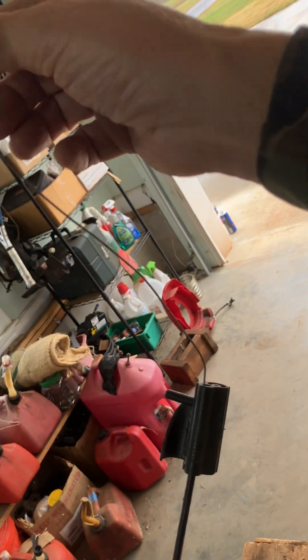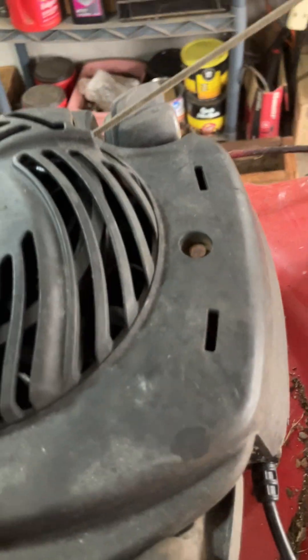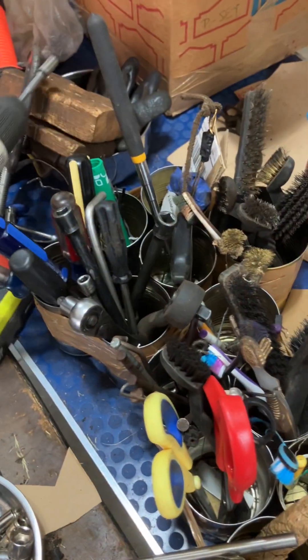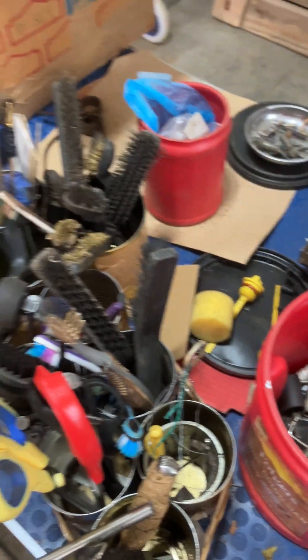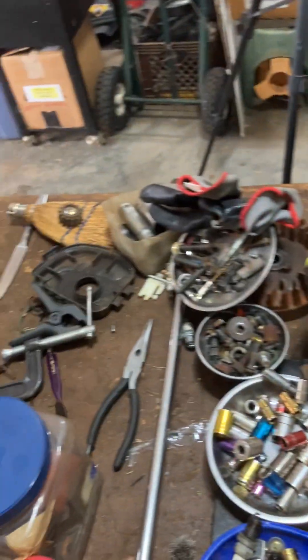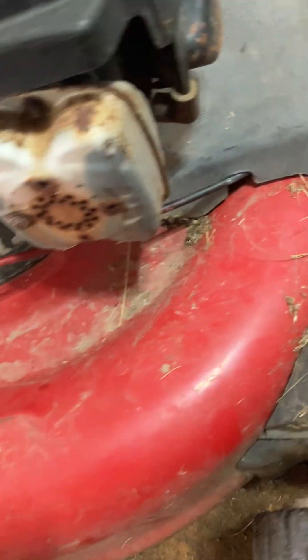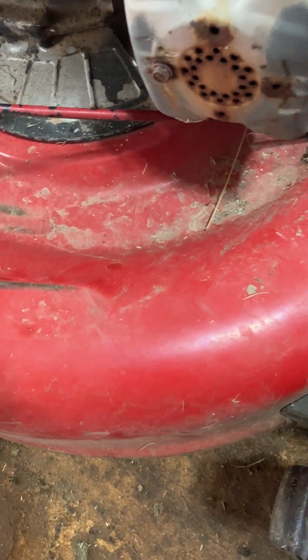What I'm going to do is take that off and cut it right up here. I'll do that now while we're doing this together — let me get my really good cable cutters. To cut through these cables there's some strong steel, so you've got to get something good to cut this cable. I'm going to cut it right up in here so the self-propel is totally disabled.